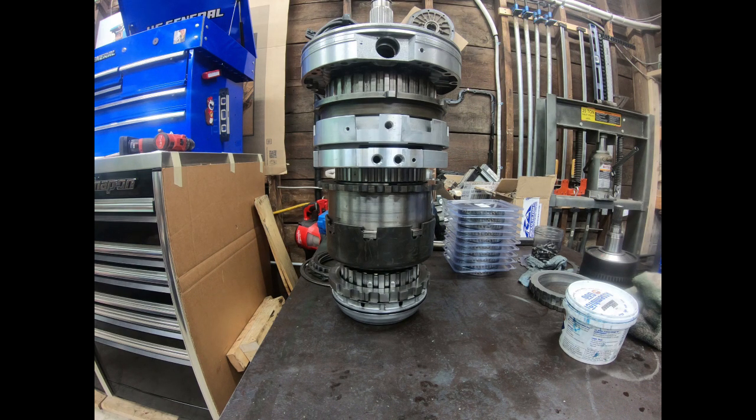What does all this mean for the 4R100? All these vibrations affect anything bolted to it. The bell housing is bolted to the engine, so it's going to see all these vibrations. The torque converter is bolted to the flex plate, which is bolted to the crankshaft. There's also a fifth force — a rotational torsional force that only affects the crankshaft or anything bolted to it, and that's why the harmonic balancer is important. On the back end of that crankshaft is the flex plate, and the torque converter is bolted to that. That's why flex plates take a beating.